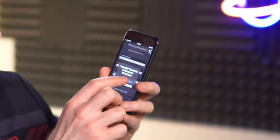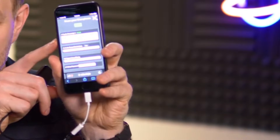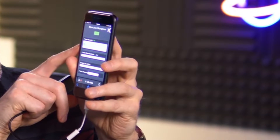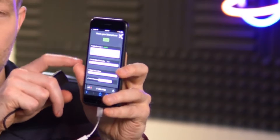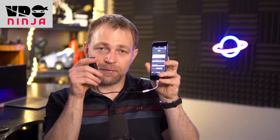So let's connect the TRS-to-TRRS adapter to our Apple adapter and see what happens. We'll refresh, make sure the mic's on, click 'share your microphone,' and allow. We can see that the audio source is now listed as a headset microphone, and the iPhone's internal microphone is shown but not selected — so we have two microphones to choose from, and the headset is selected by default. This shows that we need a communications device as the input — specifically something the phone treats as a headset, not just a microphone.